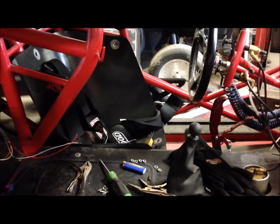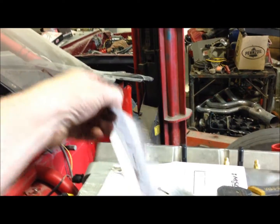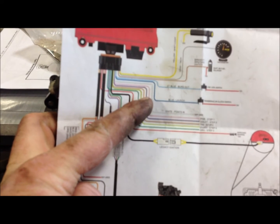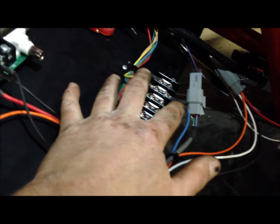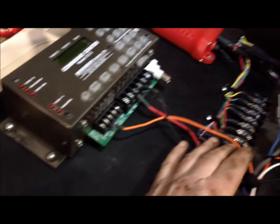I've got to go to town and get some dark blue wire. I want to try and keep these wires color-coded according to the instructions, so that if there's ever a problem that's all we've got to do is go back to this — it's got all the wire colors there. I've got a light blue for the line lock, and all I need now is a dark blue for the trans brake. So the light blue here is hooked up to the line lock, so the grid will limit the RPM when he's on the line lock button for the burnout. And I've got the trans brake hooked up to the delay box there.